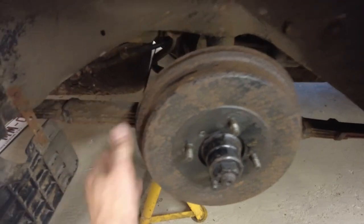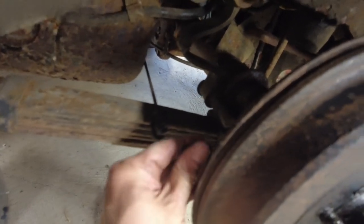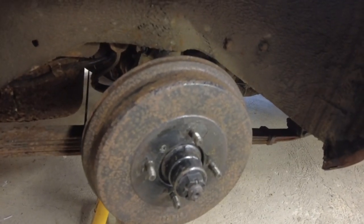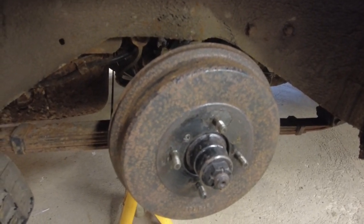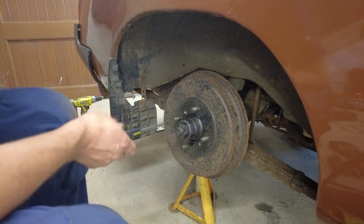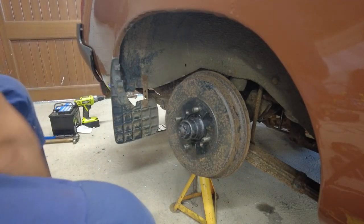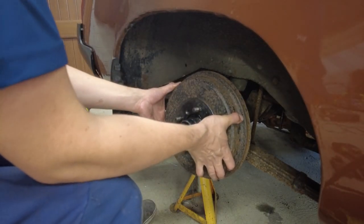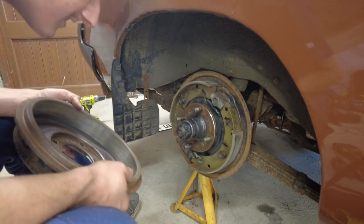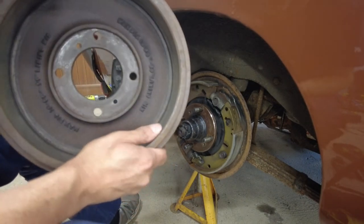I spared you the boring bit of taking off the wheel, but the first thing I've noticed is on the back of the car the handbrake cable is disconnected. The lever seems to be seized up inside the car, but let's get the drum off first and see what we're looking at inside. I'll take these two screws out - they're actually incredibly loose and oiled, so we're off to a good start. Oh yes, very nice indeed - they're practically new, the drums are in very good order as well.